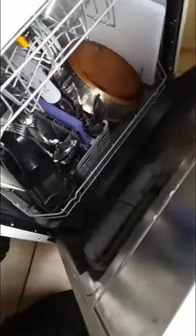What I'm going to do is quickly look in it. Somewhere in here, there's a sensor which goes up and down, and it's there in case there's a big leak, and it goes up and it'll keep sucking water until the water's gone, and that's what's probably stuck. So let's have a look. Also, something you could try as well, when you open the door, still does the same. You should actually try cleaning the whole machine out. Make sure there's no blockage. Quite often there's a blockage here coming out.